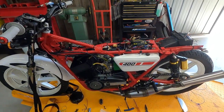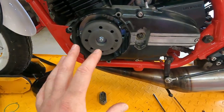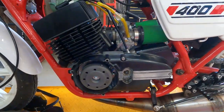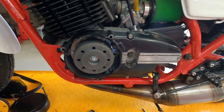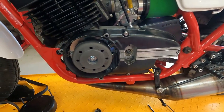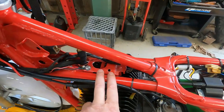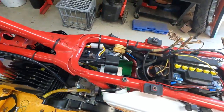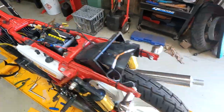Okay, recap — it's been a few days. Got all the stator and everything in there, that's all pretty straightforward — removing the old one, fitting the new one, got it all timed up. Make sure you space that pickup coil away from the rotor — you don't want to damage the end of that pickup coil. Fitted the coil — of course it didn't fit where it was supposed to fit. I don't know how they get them in there, but mine didn't fit. So I've just made a bracket and mounted it there. Because I'm not running an airbox — I've got pod filters — I can do that.